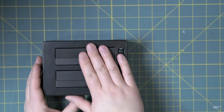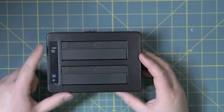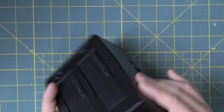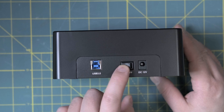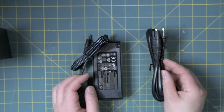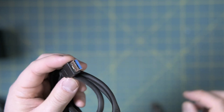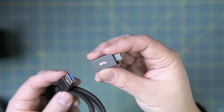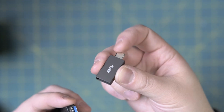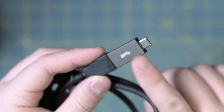The first thing out of the box is the dual docking bay station itself. On the front you can see the LED display with the percentage sign. It's a dual bay docking station with LED indicators on the side — power, source hard drive 1, hard drive 2, and the clone button. At the back there's the USB 3 input, the on/off switch, and the 12V DC input. It also includes a power brick, a USB 3 cable, and a USB-C to USB Type-A adapter. If you want to use the USB-C port on your computer for faster speeds, you can use that adapter as well.